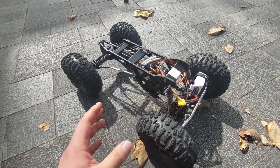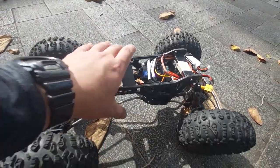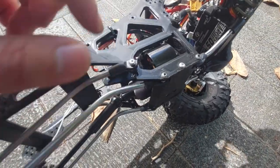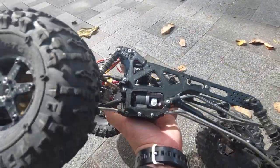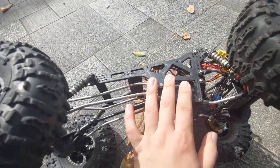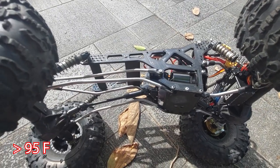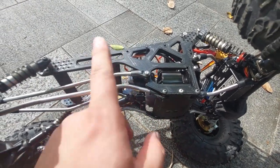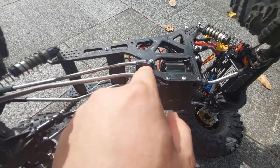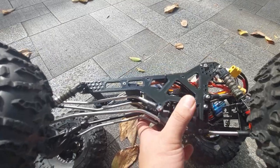Today it's actually done really well. I've been running this in the heat for around 45 minutes and the PLA has held up just fine, a lot better than I expected. Other than the breakage where we sheared the upper rear link mount, the truck actually performed pretty well. It's basically as hot as it gets here at around 35 Celsius, and I don't think this breakage is due to heat at all — it was just a really hard fall. I'm just going to beef that up a little and add a bit more material to the edge.